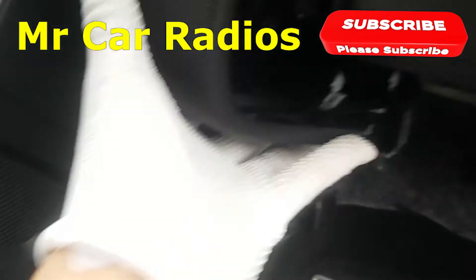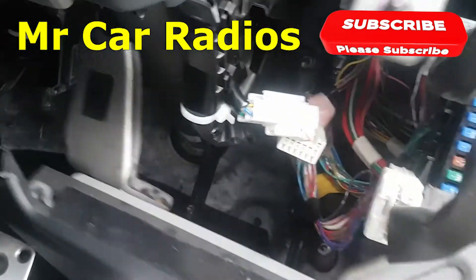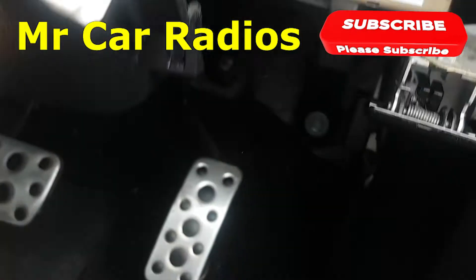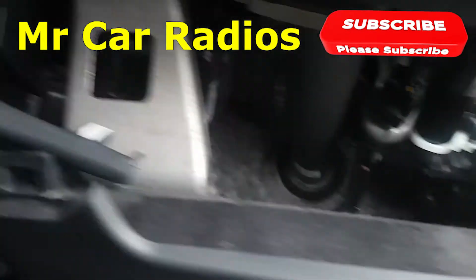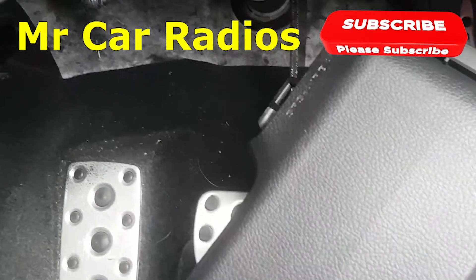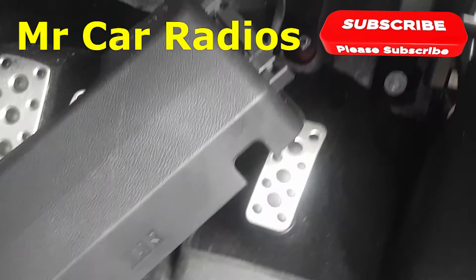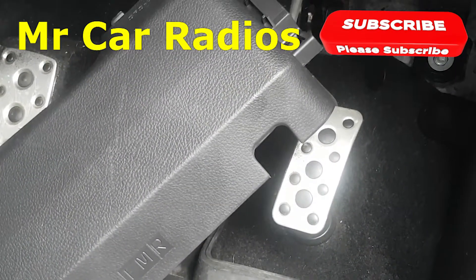After that, there's this piece under here — it also has one screw. Near the airbag there, the airbag has one screw here and one screw inside there. Just clip this piece out and drop it down — no need to take it out at all, just leave it. Take the two airbag screws out and drop the airbag on the floor. Don't unplug it, just leave it alone. Make sure the key is turned off.